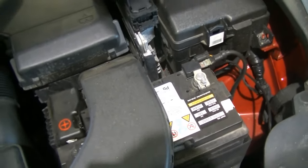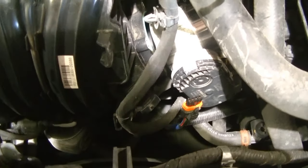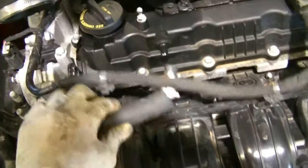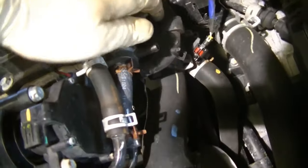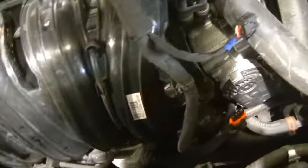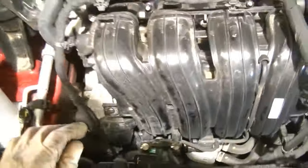First thing I'm going to do is disconnect the negative terminal. We're in the middle of our intake manifold removal. Hyundai runs coolant through their throttle body, so to prevent yourself from having to drain the cooling system, just unbolt the throttle body from the intake manifold — that way you can pull the manifold and leave the throttle body in the car. You're going to have a vacuum line up here to disconnect, and two over here. I disconnect it on this side and leave the purge valve connected to the manifold. You also have to unhook the harness from the manifold, disconnect your injector harness, and your knock sensor harness from the bracket on the front of the manifold. Now I'm going to pull all the bolts and nuts that secure the intake manifold — one, two, three, four, and five, plus one on this side hiding. There's also a little bracket underneath the intake manifold with two 12-millimeter bolts you have to take off.